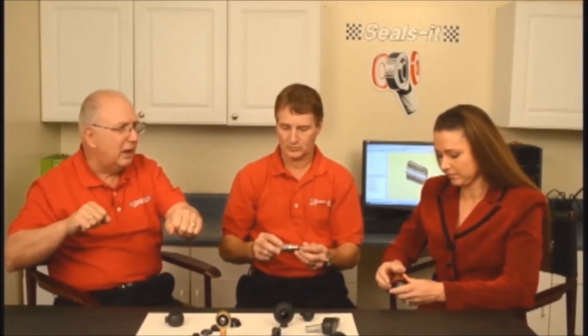Exactly. Some of the drivers are using these on the rear suspension on the right rear, and when they step on the brake, it pulls back, and by the right rear going back, it frees the car up going in. When they step on the gas, it's trying to climb forward, and it compresses this seal. It allows the right rear to go forward and increase bite. It's been a very successful and very popular piece in the race car group. We also send it over into agriculture.